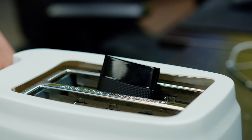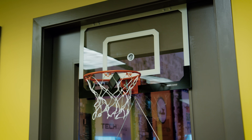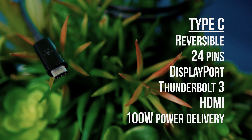After 8,000 insertions, the USB Type-C drive is working perfectly, with a connection feel that I would actually go as far as to still trust. But the Micro-B is toast at only 80% of what it was theoretically rated for. We tried a brand new cable to see if per the spec it was actually the cable that died first — the cable is mangled but still works. This is a sample size of one, so it's not much more meaningful than anecdotal evidence. But what we have added strength to is that on top of its reversibility, extra pins for added functionality, and excellent durability, Type-C is truly a worthy replacement.